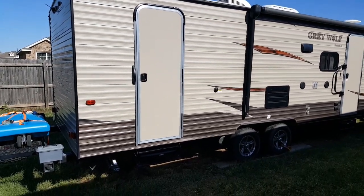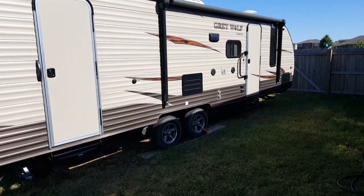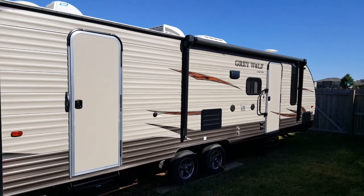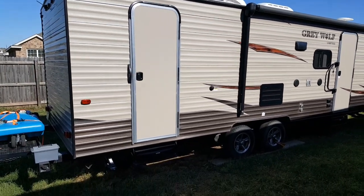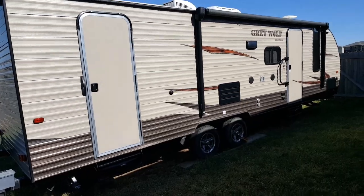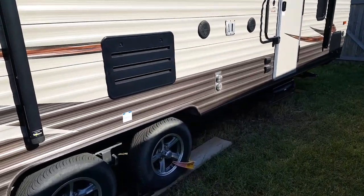So how you're going to do it, I find best, is work with one sealant at a time. My Proflex is going to be everything from the roof down, and then on the front cap down, and the same thing for the rear. I'm not going to use any of the Dicor products anywhere besides the edge of the roof and then on top of the roof. Everywhere that we find a lapse in sealant, we're going to just take a piece of tape and then mark the area.